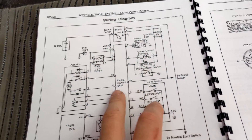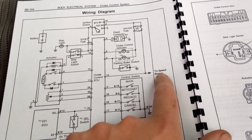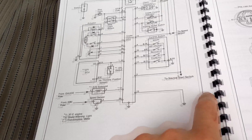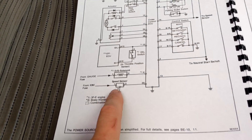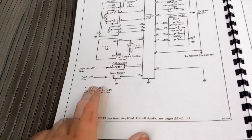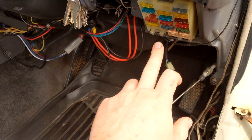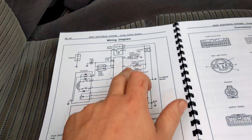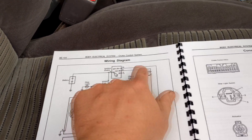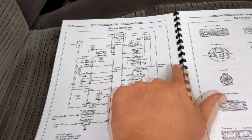Looking at my wiring diagram, power comes in from the ignition switch through the ECU IG fuse, then goes to the speed sensor. From this wire here, to pin one on the speed sensor, then to ground, and then this one comes back and gives you your actual four-pulse signal. So what I'm going to have to do is check between pin one and pin three, and see if I've got voltage there. I've checked it at the fuse and I've definitely got voltage there. This one also powers the cruise control indicator, so if that fuse was blown, or the power circuit was no good, then it wouldn't get there. So I'm going to check voltage down here, which will show that this circuit is all good.